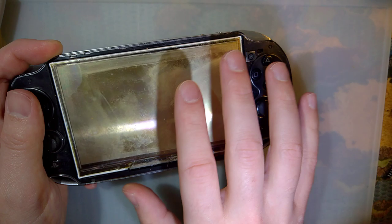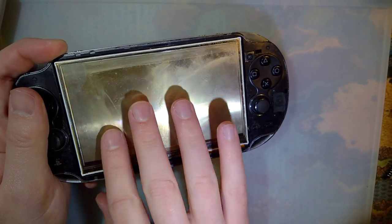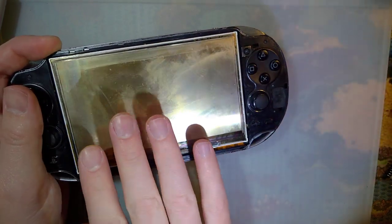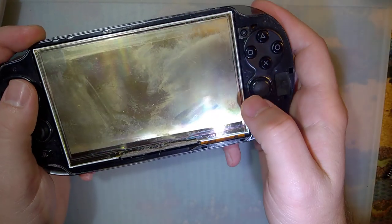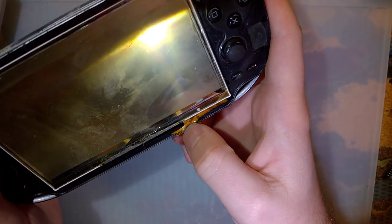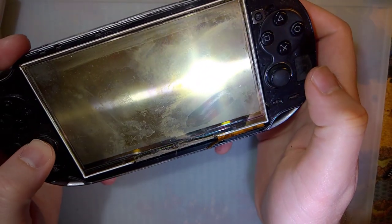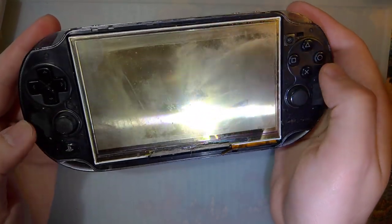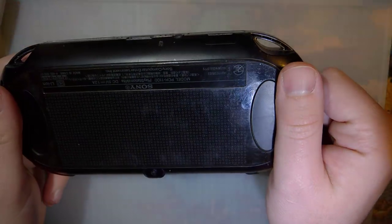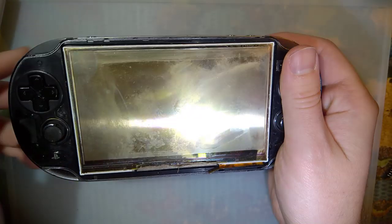Well, the problem was that someone had already tried removing the touchscreen without removing the LCD, and they had separated the two layers of the LCD itself. So that's what you're looking at here, just the lower half of the LCD. There's a few layers that are missing. Also, they went ahead and did me the favor of ripping the touchscreen off entirely. So when I removed it, I did it the violent way. And then I spent 2 hours cleaning up adhesive on this thing. But I think we determined that it works. It's just beat to hell.